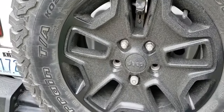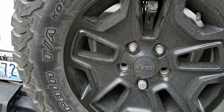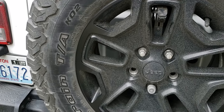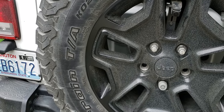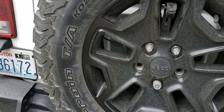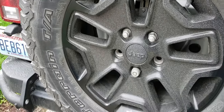Today's video is about how to determine the age of your tires. Why is that important? Maybe you don't know the age of the tires on your car, or your full-size spare. Maybe you're buying a used car and want to know the age of the tires. Or — and this is a big one — you're calling around to get a price on a brand new set of tires. You're going to spend a thousand dollars for a set of four tires; you don't want tires that are already 14 or 16 months old. You want some that are less than six months old — three months would be great. You can always ask: besides the price, what's the manufacture date?